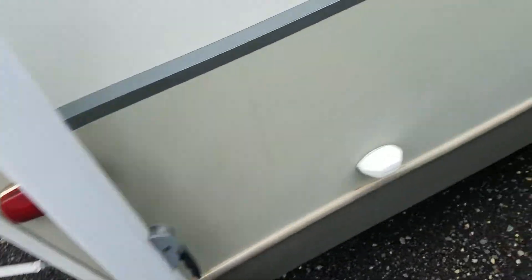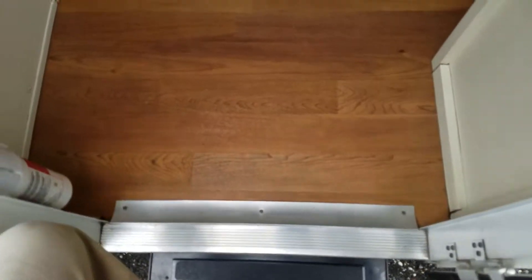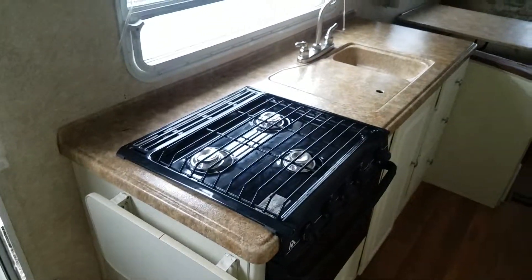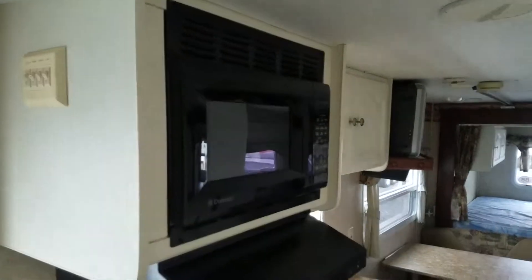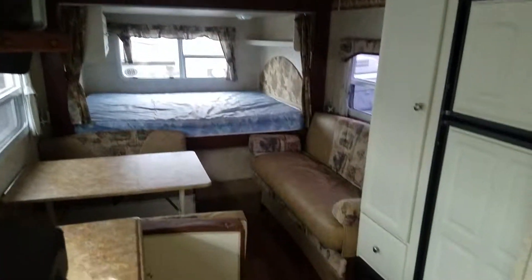You will need a tail light lens for this corner. Now let's go inside. A lot of times you're going to see soft floors in these units. Soft floors can come from two things: one, the floors they originally put in these units were very thin — I'm 230 pounds so I notice when there's a soft floor. The other thing a soft floor can come from is water and moisture that came in because of a leak that wasn't attended to.